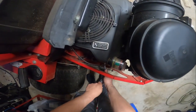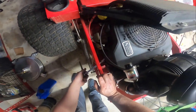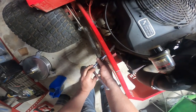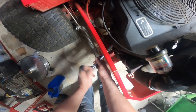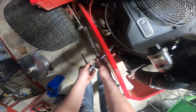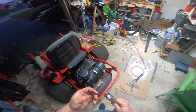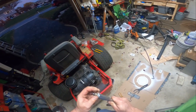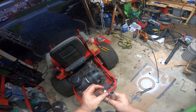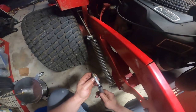17 foot-pounds, if you don't know. I'll have to pull the torque wrench out and set it for 17 foot-pounds. She was saying these were replaced last season. We're just pulling these to look at it, do a compression test, and see what kind of shenanigans are going on. Yeah, they're still white, and the porcelain's still white. That's firing very, very clean in my opinion.